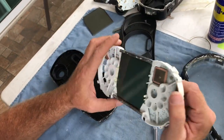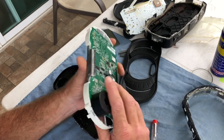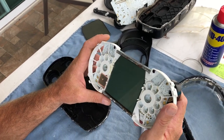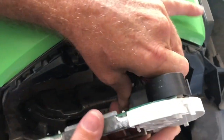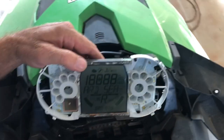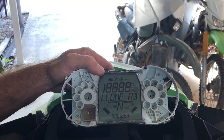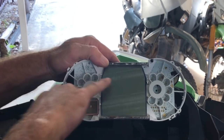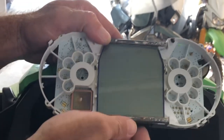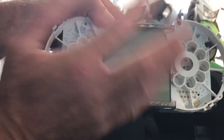Before we put it back fully, first we go to the jet ski and try if everything is working. I'm not going to put it in the whole case first — I'll do that later. First we're going to check if everything is working. You can see already — everything is fine, everything is readable again. If some things are not clear to read, that means the rubber strip is not well connected. Make it open, push the rubber strip, clean it up, and then try again. But mostly if you do it like this, all is fine again.